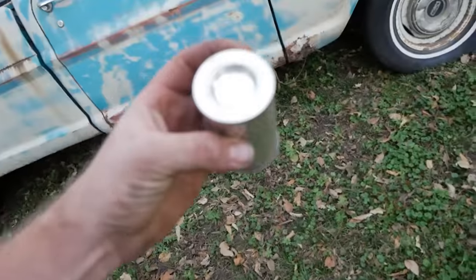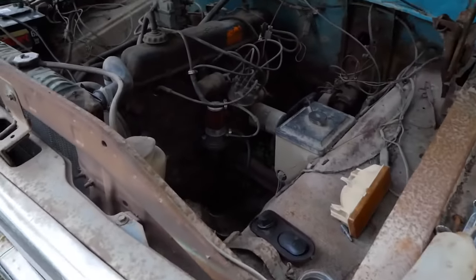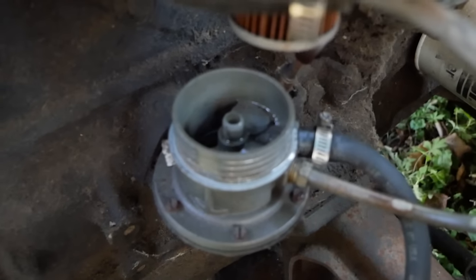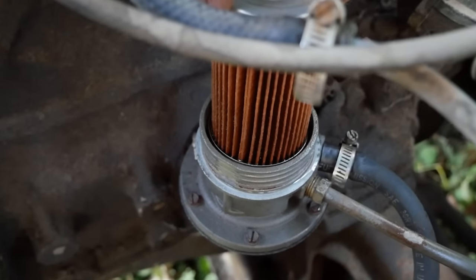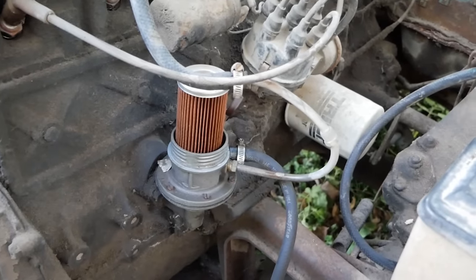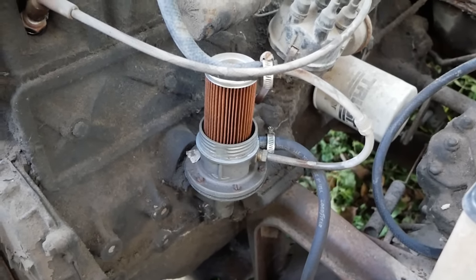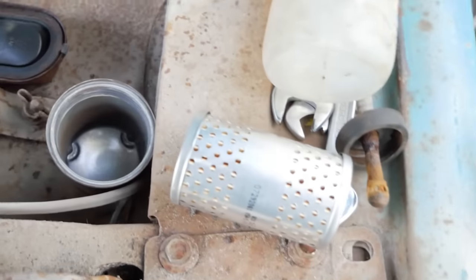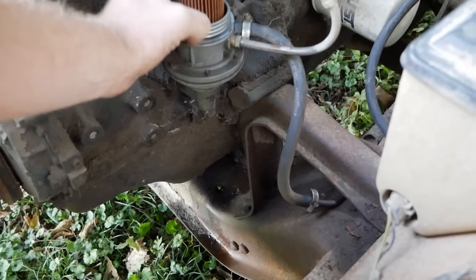Alrighty, we got our new parts, new filter, new master cylinder. Before I put this one on, I'm actually gonna run the old one a little longer. I rinsed it out a little bit with some gas and took a bunch of gas and rinsed out that basin. That basin probably had a half inch. No, it had, looking at it now, 3/4 to an inch. It was pretty much level all the way across of a rust powder in the bottom. It was disgusting. So we are going to expect more of that to come out. It's probably why it was not pulling fuel. It was so rusty. So yeah, we're going to let that old filter that has been rinsed off eat up most of that again. Do this a few times, and once we see it coming out a little bit better, we'll go ahead and put the nice new Wix filter in. So most importantly though, we got a new O-ring, so that should stop the leak and things should be happy.